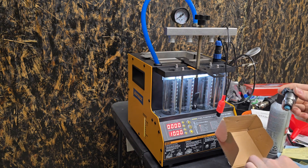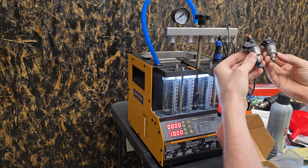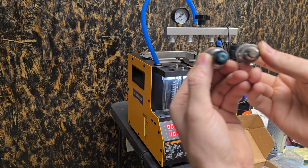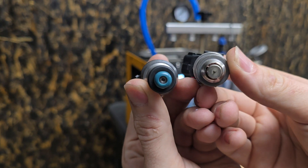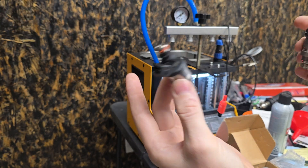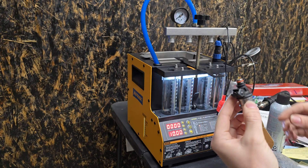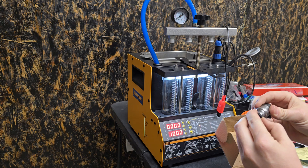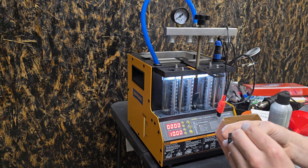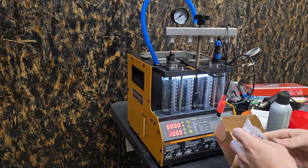Right out of the box, comparing them to a standard H-22 injector. The body looks very similar, and this one here has had a little nipple broken off on the bottom for inspection. But you can definitely tell that the opening is much larger. The factory ones are like 225 or 290cc, whereas these are supposed to be 1,000. This rubber is really good quality. The o-rings are nice — they're not hard or brittle, kind of like Teflon-style o-rings.